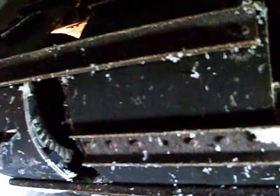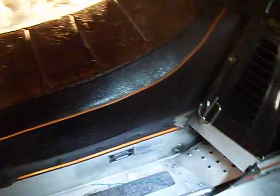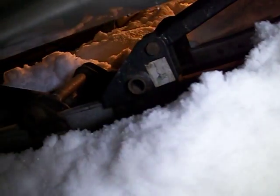As you can see, there's not any dry rot. It does not have the ice studs, which was an option back in the 70s. I did put new sliders on it this year. It hasn't been registered since 2012. I put new front springs on the skis, and the undercarriage has new front springs, a new rear shock, front swing arm and mounts, as you can see there.